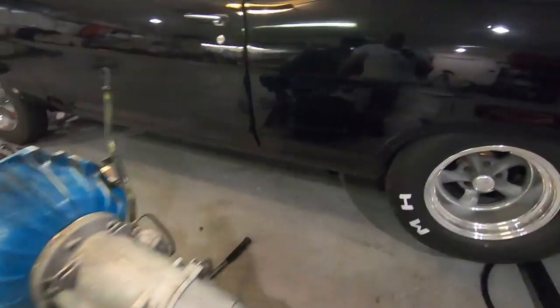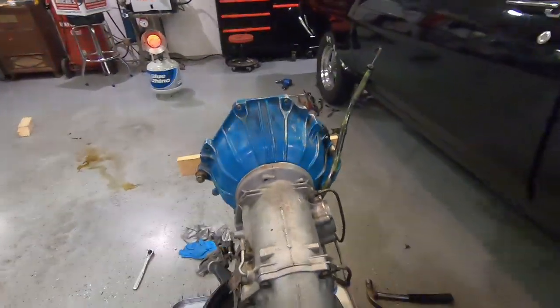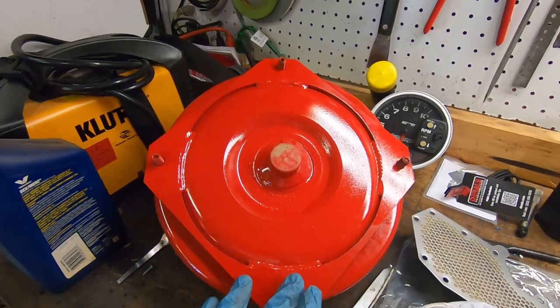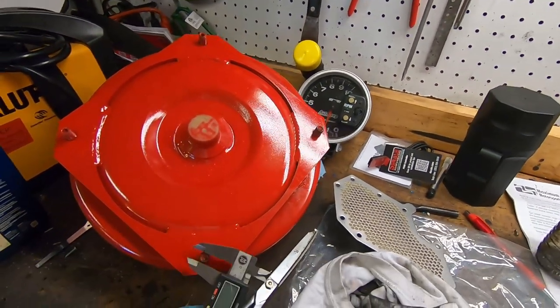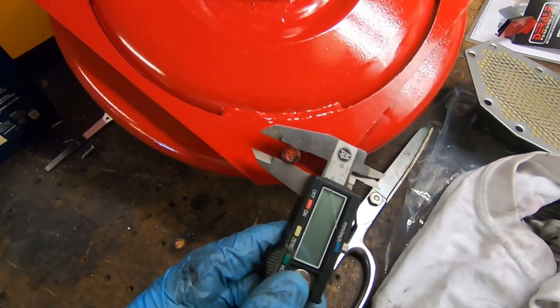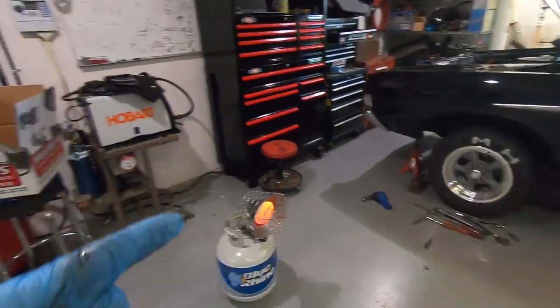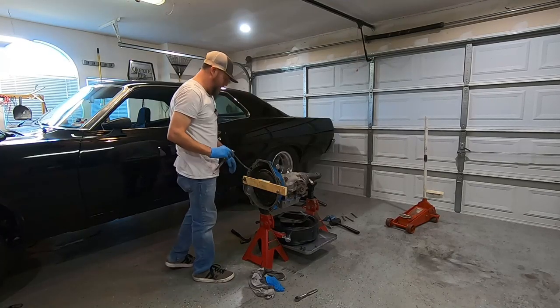The transmission is looking a lot better. I went ahead and opened up those crimped lines a bit — I think it'll be fine. Now I want to make sure the four bolt holes match up. This is a 10.5-inch bolt pattern with four bolts on the '69 C4. I want to make sure these aren't thicker than the stock ones. I'm measuring and comparing to the stock converter — and it's the exact same size. Don't have to worry about modifying the flex plate.